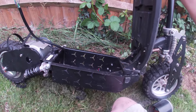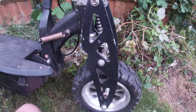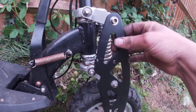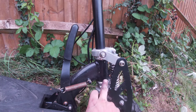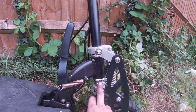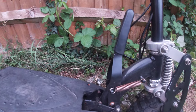This thing should absolutely fly once it's done. I'm considering replacing the shocks with air shocks. It's got this awesome fork on here - look at how awesome that suspension is. Unlike the other ones, these plates are much thicker - that's 8mm thick; the others are 4mm or 6mm. It's not a 1-inch 8th head tube - I think it's inch and a quarter, which is a pain. It's almost like a bicycle headset in reverse with threading nuts on the bottom. So you can't just swap the headset out.